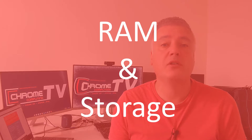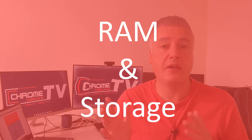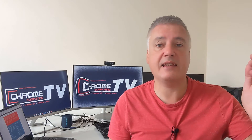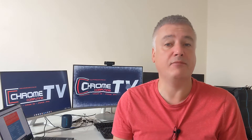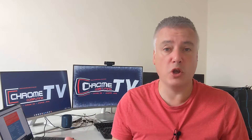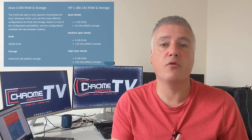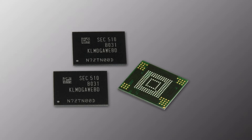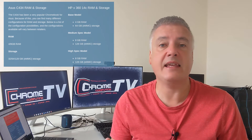The next thing is RAM and storage. When it comes to RAM and storage, it's difficult to compare the two because the ASUS C434 is a really popular Chromebook that Asus has brought out in many different configurations. It's not as simple as saying the entry level comes with 4 GB of RAM and 64 GB of storage — you can get the entry level with 8 GB as well, depending on the retailer. With the ASUS C434, configurations are either 4 GB or 8 GB of RAM, with storage of 32 GB, 64 GB, or 128 GB — all eMMC storage.